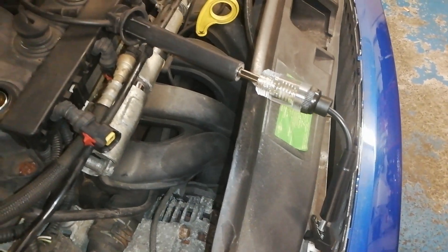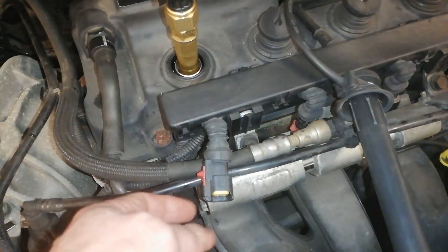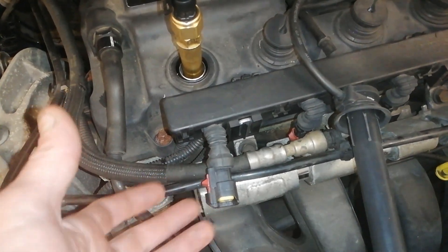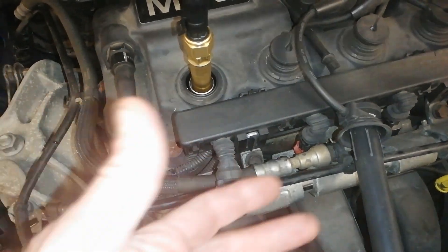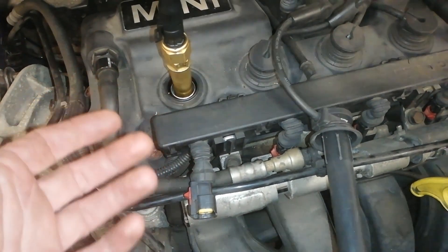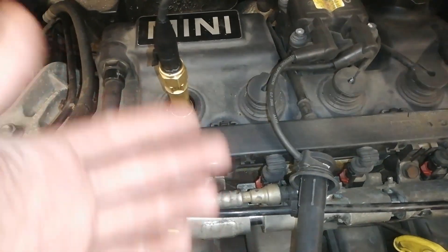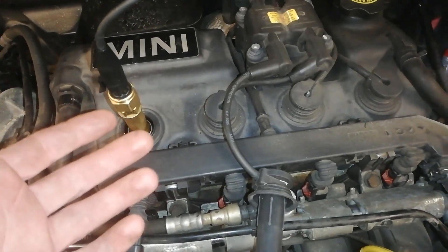I do not want to wash this cylinder with fuel, so I have the injector unplugged. If it's a GDI engine and the injector is underneath the manifold and you can't get to the plug to disconnect it, you want to keep your cranking to a minimum - just a couple of turns, let it run, then switch it off and get your capture from there. For the purposes of demonstration here I'm keeping it disconnected, and I'm only running it for a few seconds for every capture.